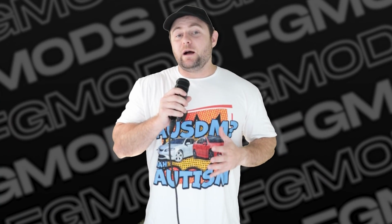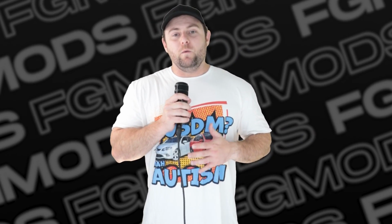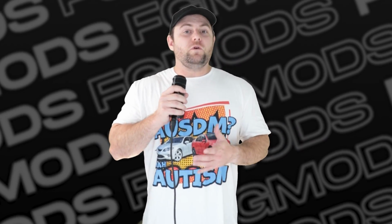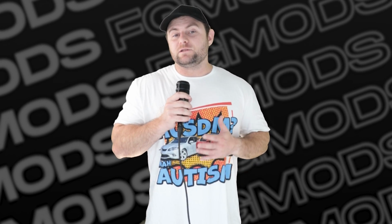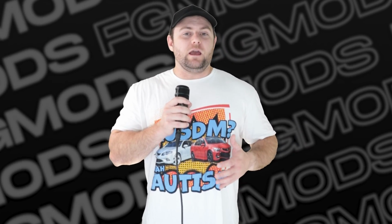Overall, I'd say this Aftermarket Industries surge tank was really easy to install. It's actually kind of incredible how simple it is once you understand how it works and how to install it, and that it can handle, in the right configuration, 1400 horsepower. But I mean, they've got the results. There's a whole heap of Falcons, Commodores, other cars running this system or systems similar to it and achieving incredible numbers.